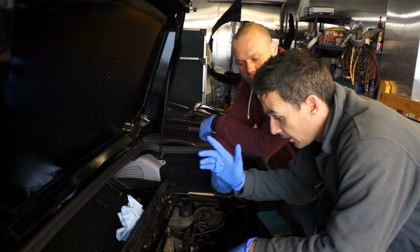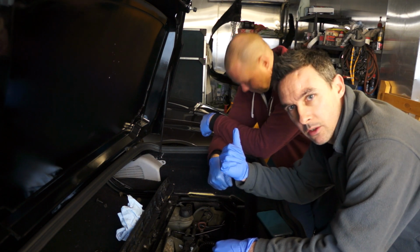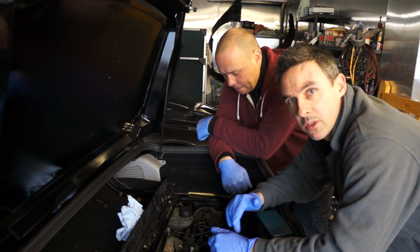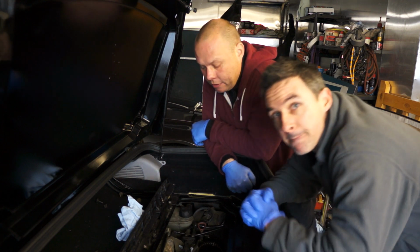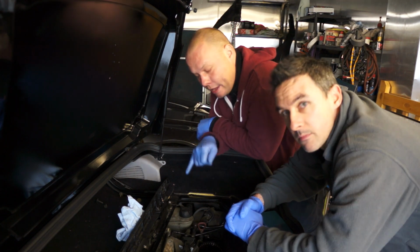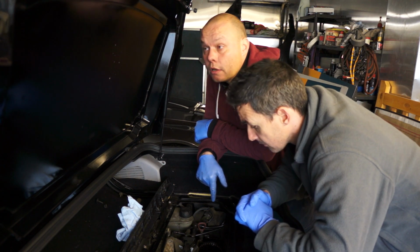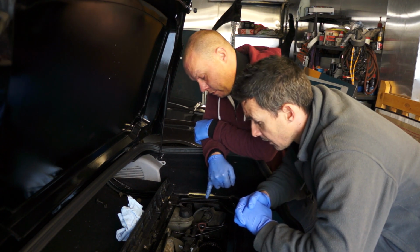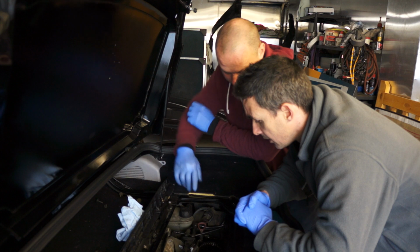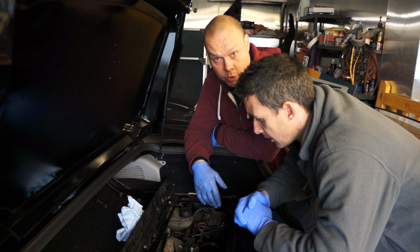Okay, so we're about to start on the stripping process. So Darren's going to talk us through what we're going to be doing today. He's done a lot of research on it, and obviously there's a sequence. Procedure, yeah. So talk us through, Darren, what we're going to do. Basically, very quickly, we're going to be taking off the alternator cover down below so we can get to the belt to slacken the alternator and the aircon. Take the belts off. Crack the crankshaft pulley bolt, remove that, then we've got to remove the timing case covers, which will then give us access to the rest. So then we basically just start to undo the cylinder bolts and lift it off. That's a very quick version.